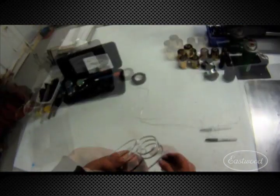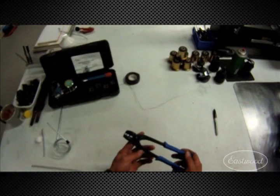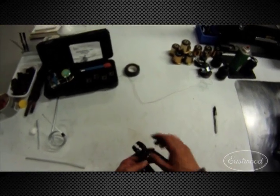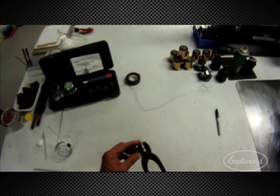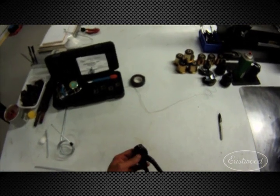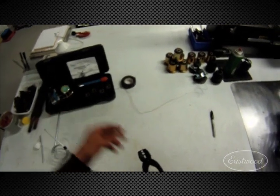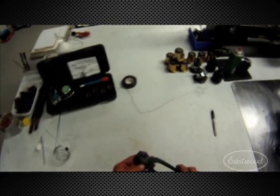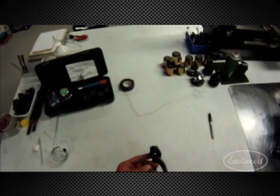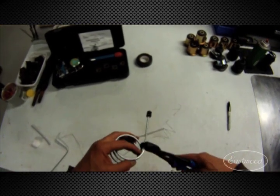Now I'll show you a quick, easy way to form some 90s with Eastwood's brake forming plier, and you're going to have professional-looking line. This is the Eastwood brake forming plier — it's sized for your most common brake line sizes. It's used for tweaking and final bending. Even if you buy preformed kits you're going to need to do some tweaking, but for those of us making lines from scratch, making sure they fit the way we want, tweaking them around stuff — even preformed kits. Even if you're going to run a line lock, you still have to form your own lines for that.